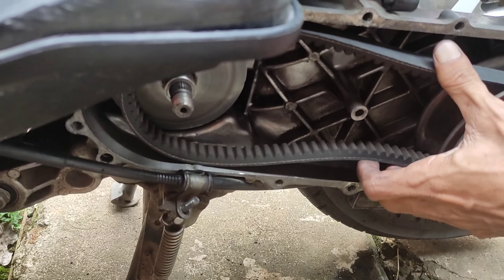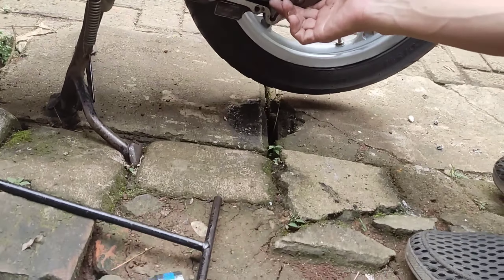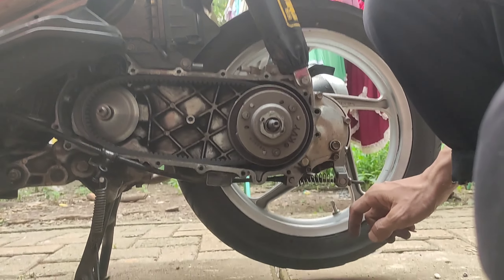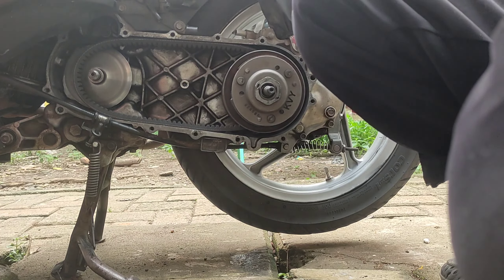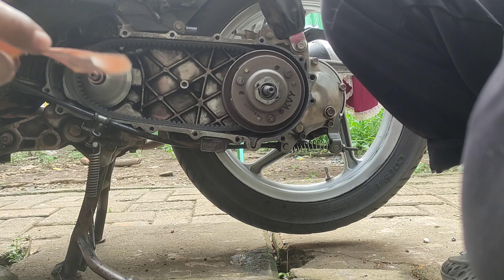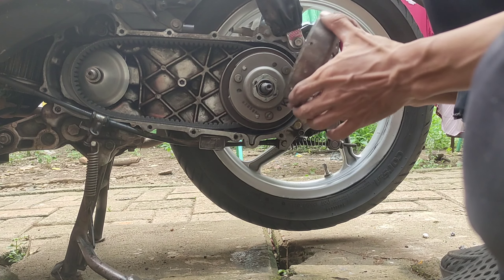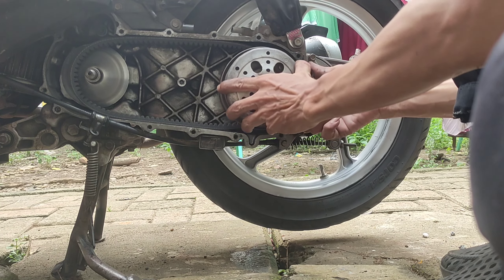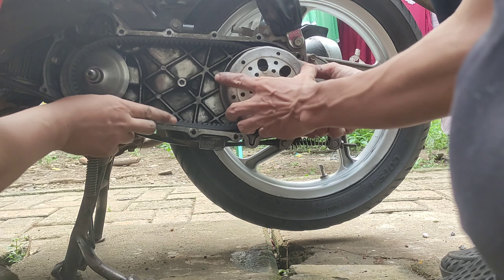Okay, let's install it for now. After it's installed, I'll check carefully — turns out it's not leaking at the back, the seal is safe. For those with the same problem where the housing is cracked, I recommend using two-component glue — you can buy it online, I'll include the image in the video. No need to bring it to a lathe shop, because according to my senior mechanic, if you fix it at the lathe shop, it will warp.